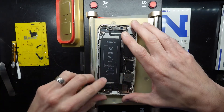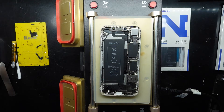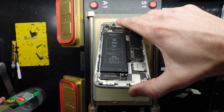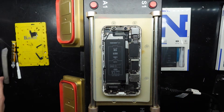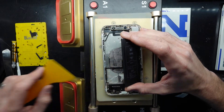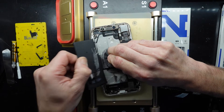Now your phone may have pull tabs, but I find these on iPhones mostly tend to snap and fail and are usually quite useless. What I'd recommend is using some isopropyl alcohol if you've got it — dribble it down this section and up high and it should work its way down the phone. This stuff usually absolutely eats glue, which makes getting the battery out considerably easier. I'm going to use the battery spatula that comes with the Nohan kit to just lift it out.